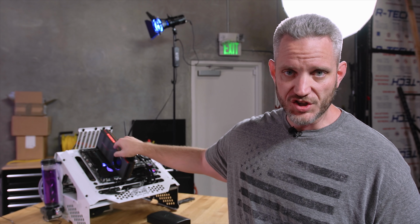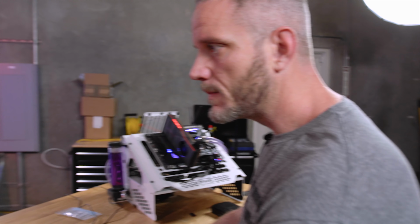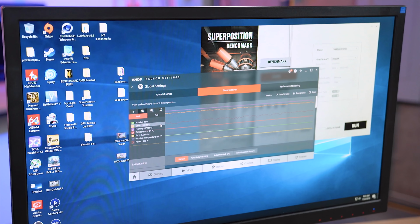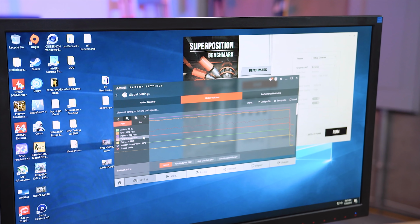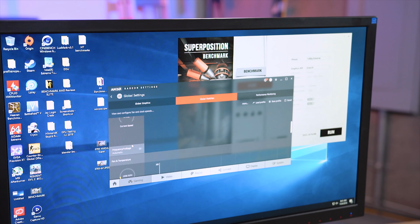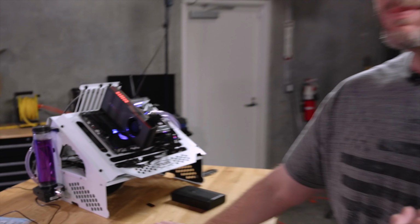The factory fan curve is extremely conservative, where it's favoring high temp over acoustics, which is making everything heat soak really, really badly. So this would be even hotter if it were in a chassis and it wasn't exhausting very well. So let's go ahead and hop in here to Global Wattman and let's see what our temperatures were. So our GPU max was 1932, and our temperature was 84°C. And if we come down here to T junction, you can see they're currently the same right now, but it's not showing us. Oh, junction temp, 98°C. Now these seem extremely out of control, but they're not. And we covered that with the Radeon 7.